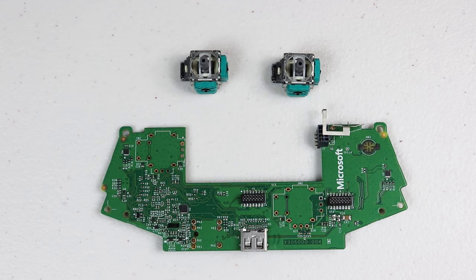The next misunderstanding primarily comes from those who've already attempted to replace a joystick without doing any manual calibration. The claim is usually that the joystick made their stick drift worse, which is simply not the case. What's really happening is that the joystick is reading off-center because the new joystick that was put in doesn't match up very well with the original joystick.